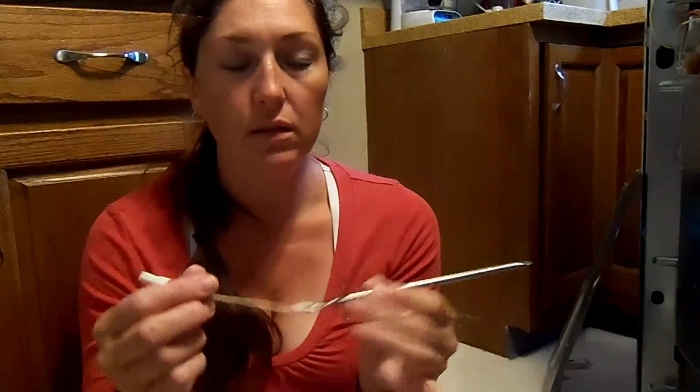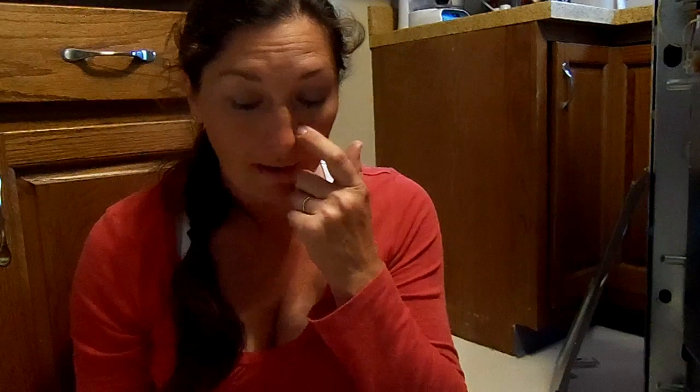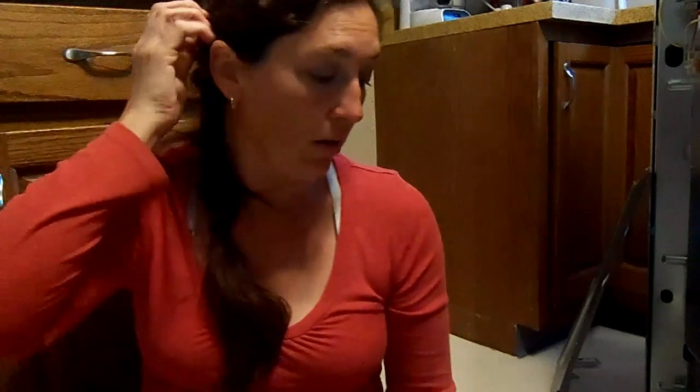Today we are fixing a Kenmore oven, and what we're doing is replacing an oven sensor. This is the actual piece. This is made by Whirlpool. I got this part from a company called Exact Replacement Parts. It's not the factory certified parts that I usually get, and the part number is ERW10181986. And I'll add that in the description for you also.